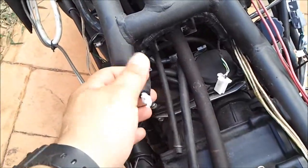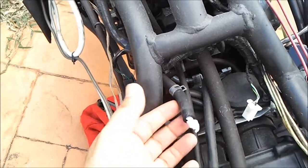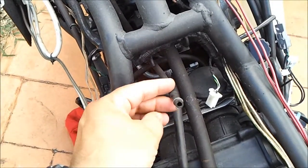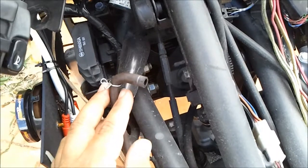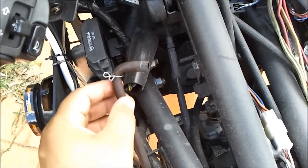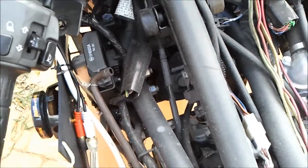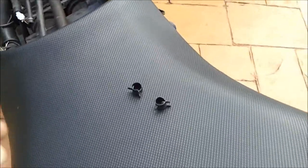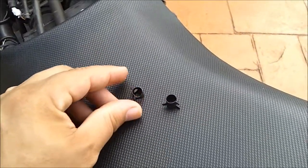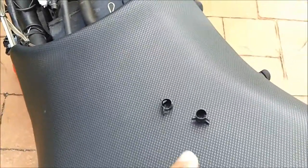So this is one of the hoses that goes onto the gas tank, and this one has a clamp that held up really nicely — no problem with that one. But then this is the other hose, and it has this little crappy clamp here which really doesn't do anything, doesn't hold anything. Same with this one — the third and last hose — it also has that little clamp which I didn't like. I went to Discount Auto Parts or Advanced Auto Parts and bought these, which are pretty much the same as the good clamp, just a smaller version for those smaller hoses.